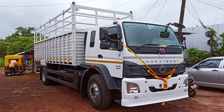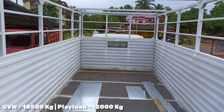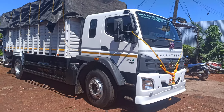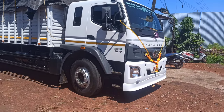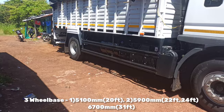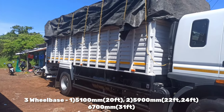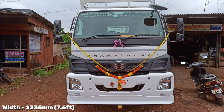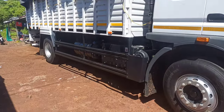Let's talk about configuration. The GVW gross vehicle weight is 18,500 kg. The payload is 12,000 kg. This current variant is cabin with load body; you can also get cabin and chassis. The cabin tilt mechanism is hydraulic. There are 3 wheelbases available: 5100 mm for the 20-foot cargo body, 5900 mm for 22-foot and 24-foot options, and 6700 mm for the 31-foot body. Width is 7.6 feet and height is 2590 mm. The axle configuration is 4x2.